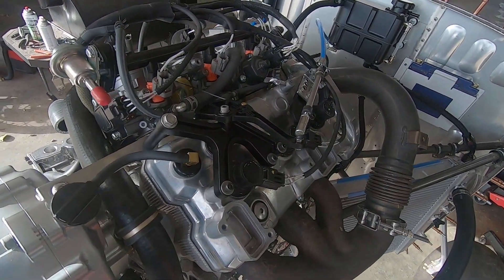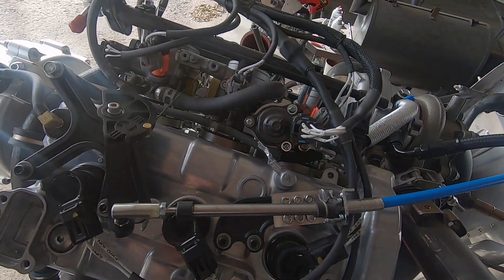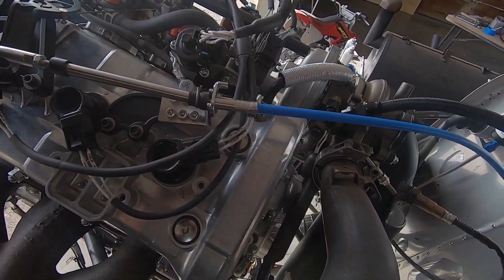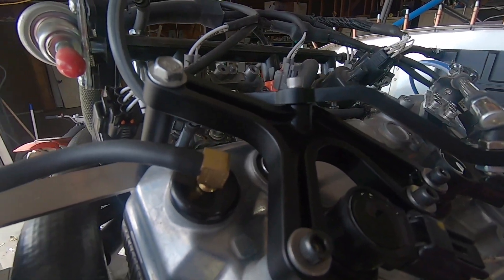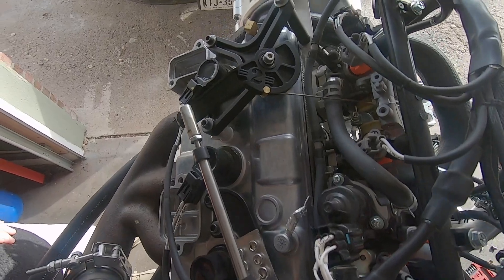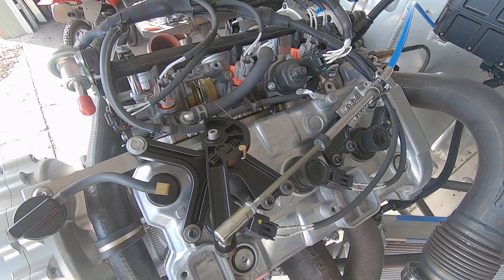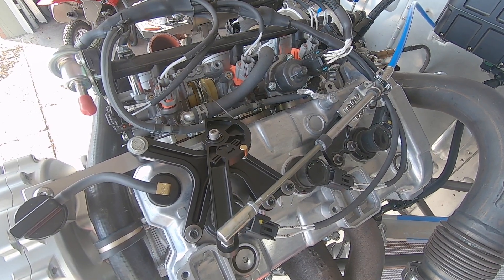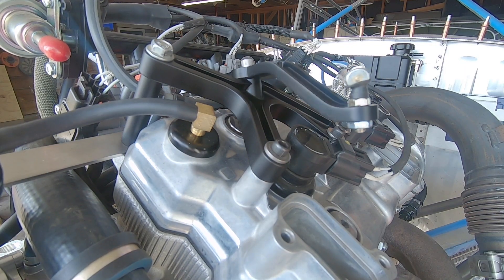Let's jump over and see what this looks like in real life. All the parts you see in black anodizing are 6061 aluminum with the exception of that main bell crank — for that one I used 7075, as it does interact with the stainless steel throttle cable and I wanted it to be harder. It rides on a bearing and it's all held in place with a snap ring. This setup will only fit on the turbo 3-cylinder Yamaha engine since it uses those stock bosses on the valve cover to secure it in place. If or when I offer these for sale, I'll include a cable with permanent barrels rather than the set screw style that you see here.